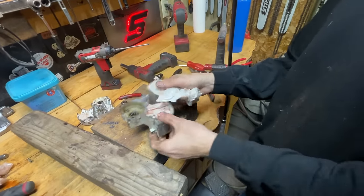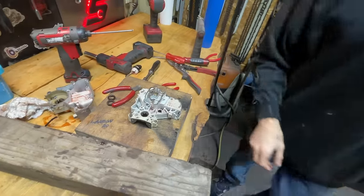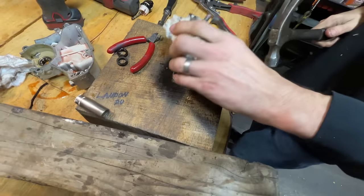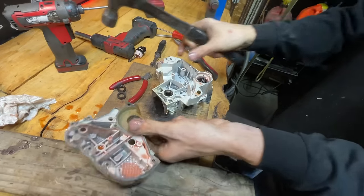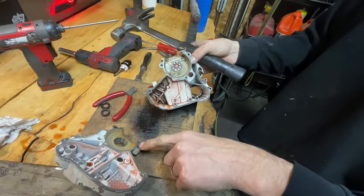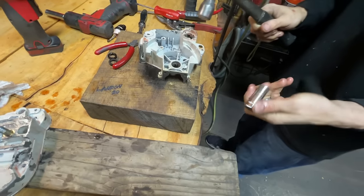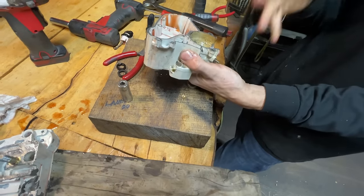The whole moral of the story is you cannot powder coat it with that in there — it melts and starts on fire. Now the bearings do pound out as well, with a 14mm. There are these two little spacer guides that go into two holes to center up the crankcase, so you want to do it on wood. If you pound it on metal you fold them over. You need a somewhat hard surface, but not anything harder than the aluminum.